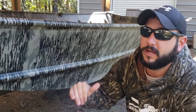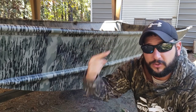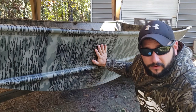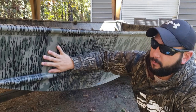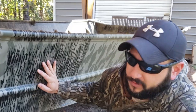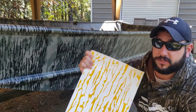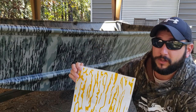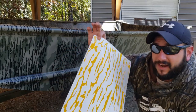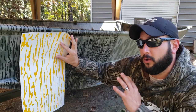I'm going to do this the same way I would on a Cerakote or hydro-dipping project. We're going to scuff all the old paint, then paint the entire boat black. After that, I've had Avery Dennison vinyl stencils custom-made at a local shop — the same high-heat stencil material we use on Cerakote projects. It peels really well and works perfectly with One Hit Wonder paint. I have enough stencils to go all the way around the boat, and we'll put the line stencils down over the dried black.